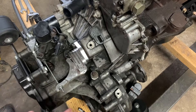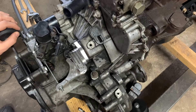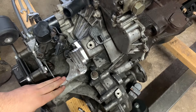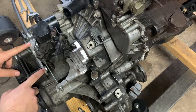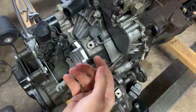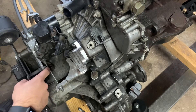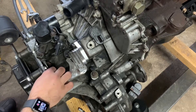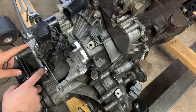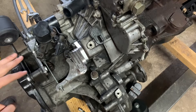The next part is the manual clutch conversion kit and the trans mount. It's a pretty trick system. For the manual clutch conversion, it uses this plate here. Your clutch cable goes through and hooks up to the clutch using a Mark 1 clutch adapter. There are threads on one side, and on the other side you use a recessed nut, so it fits really seamlessly — no impact on the cable, which is really nice. Once you get the orientation right for where it holds the cable and screw that in, you're pretty much good to roll.